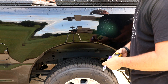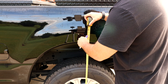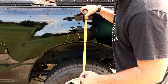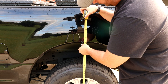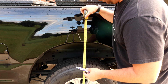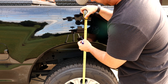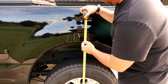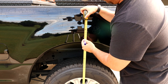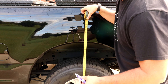The tip is super simple. When we're measuring our wheel wells, we definitely want to be in the middle of the wheel. But by the time you've messed around with that hitch and tried to fine-tune it once or twice, a lot of times you can't remember exactly where you measured. So I like to go to the first nice full measurement — in this case it's 44 — and I'll pop an arrow right there with a dry erase marker so I remember which side I measured, then label it 44. I like having that nice round number, that arrow, and not having to remember my measurements when fine-tuning.